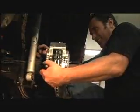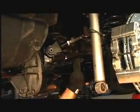In order to get the control arms in the car, sometimes it's necessary to jack the rear end up or down or wiggle it side to side. This is when it's helpful to be there with more than one person. It could be done alone, but sometimes that's just a pain in the neck. One hit. Next step is to test fit the sway bar inside the frame rails.